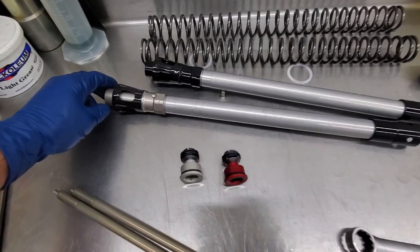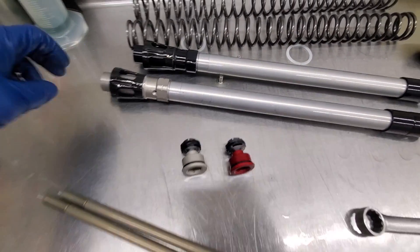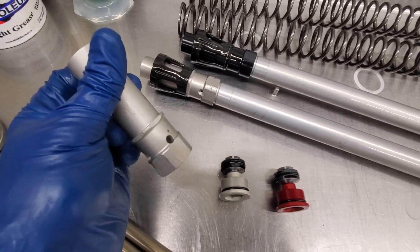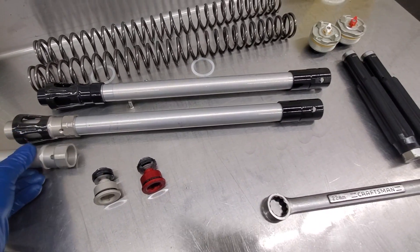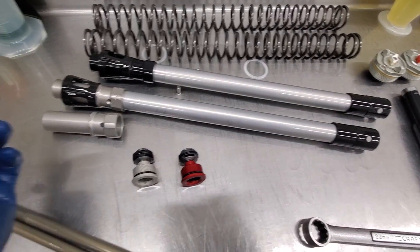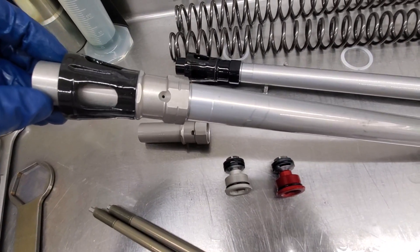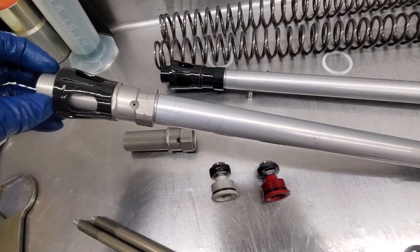One of the things we saw right away for 2022 is the lack of holes on the compression side of the fork. I'll get an old one for comparison — you can see there are four, about a quarter-inch holes. Essentially, this compression side fork really wasn't doing much before. If you imagine you have that fixed piston, compression oil is just bleeding off right through those ports. They considerably reduced that — the diameter here is, I'd guess, maybe a couple of sixteenths of an inch, maybe two or three millimeters — with no other holes all the way around.